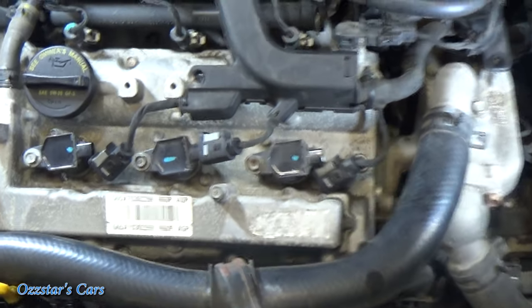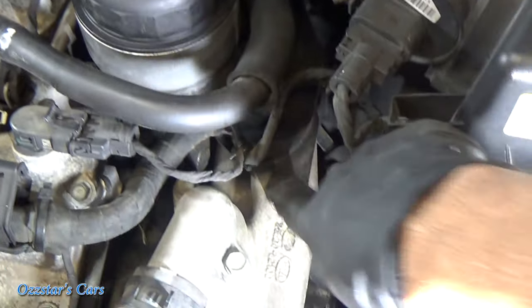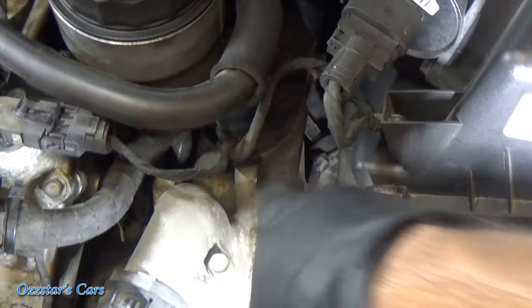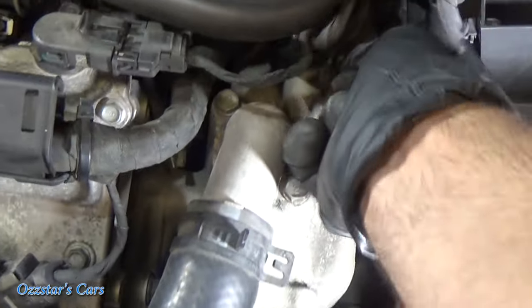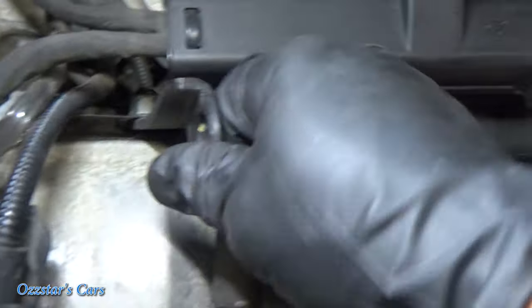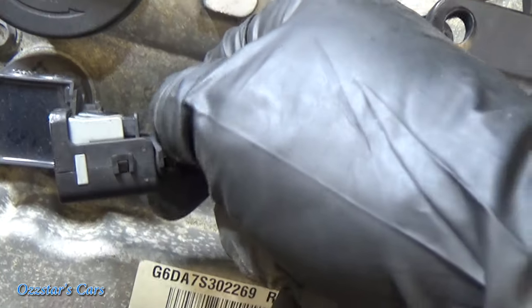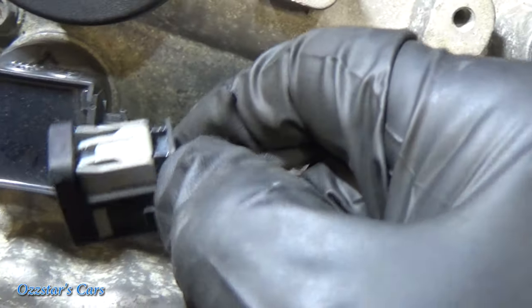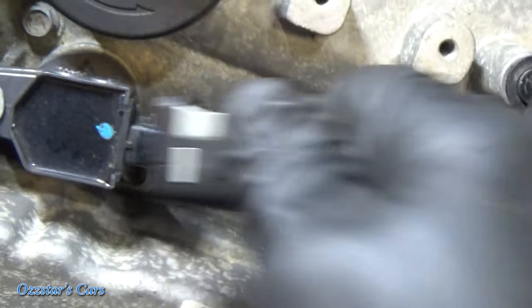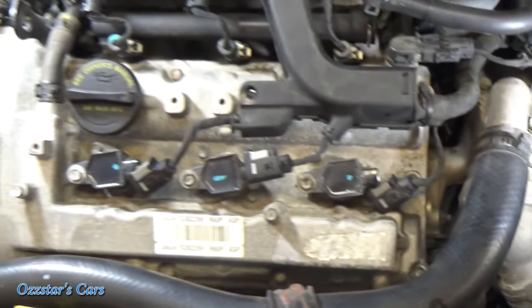Here are the three bolts for this part of the harness. Down here the harness runs along and there's another plastic bracket. I took this 10 millimeter bolt out and there's one more back there you can't quite see on film — catty corner, about three inches back. Once you get that out, you have some looseness so you can stretch this and get it out of your way. Here's the engine bracket loose, with the 14 millimeter bolt down there.